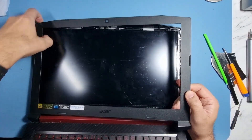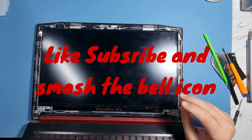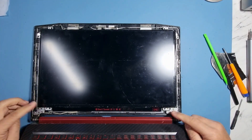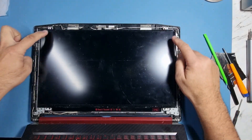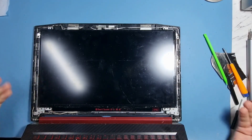Be careful — you don't want to break any of the clips on the outer side. You may break one or two here and there, but you can still bond stuff down if you have to. That was a clean removal of the bezel. The screen has got a frame with four screws. We don't need to remove the hinges — they're not attached to the screen.